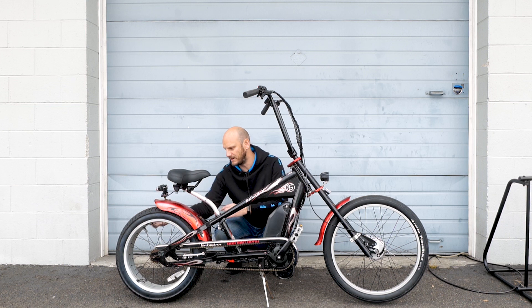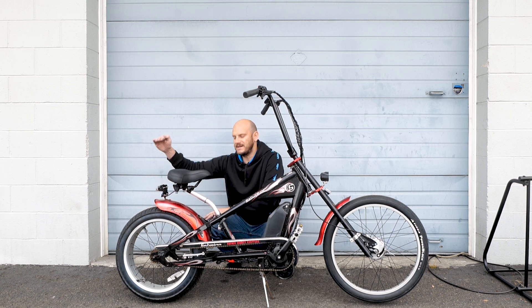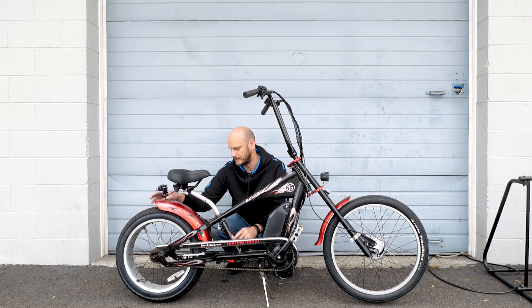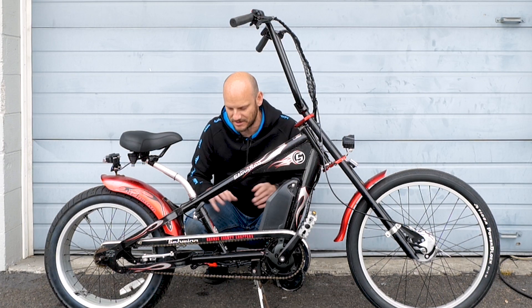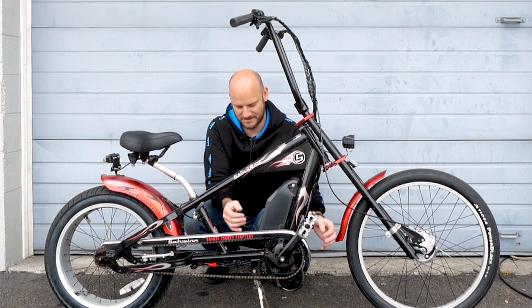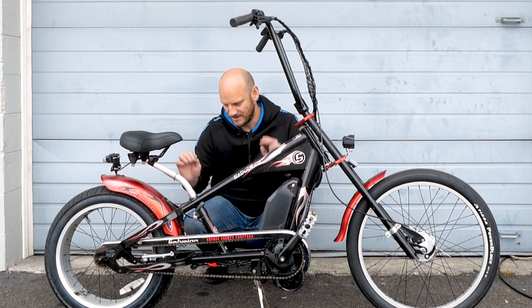So with a roughly 2-to-1 ratio, because this is a small tire — if this were a big tire you'd want to go probably even smaller, like 36 or even 28 teeth. But the good thing is you could always change it. You're not married to one solution. Just put a bigger or smaller sprocket on, resize your chain, and you're good to go.